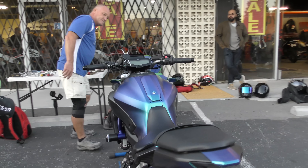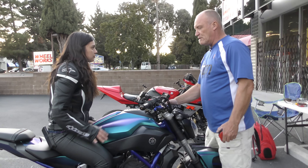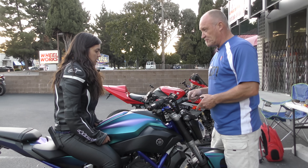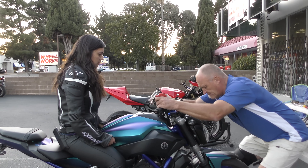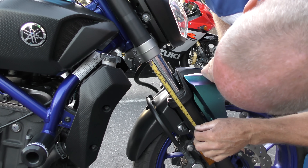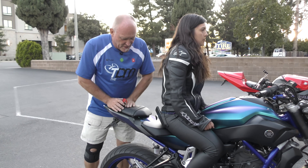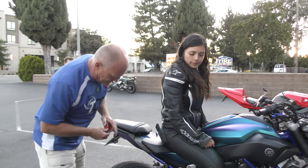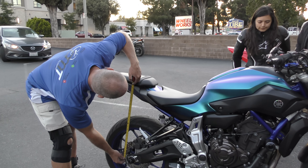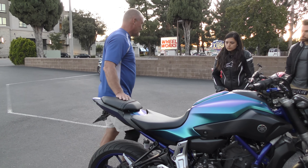Take a seat. Would you like the bike softer so you can get more of your feet down? I'm tippy-toeing as it is right now. If we could make it softer and slightly lower, that would be good. So that is 120 with you on it. Feel the spring in your back — if we soften that tension the spring will be a lot less. 70. Dismount for me. As you've only got 15 millimeters of sag in the back, that makes a lot of sense because you also have zero static sag. You're the second kid on a trampoline.